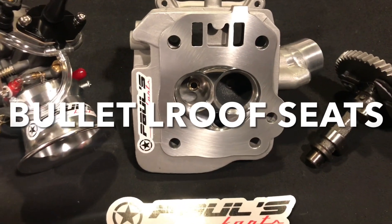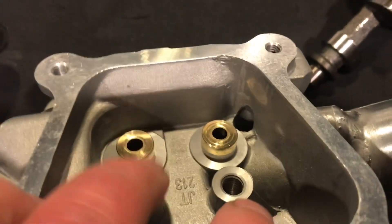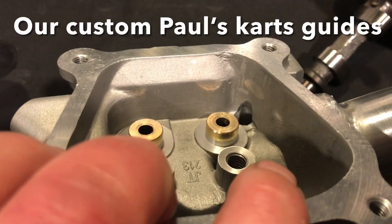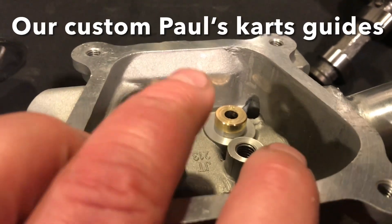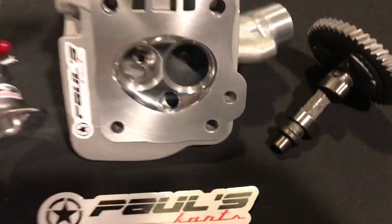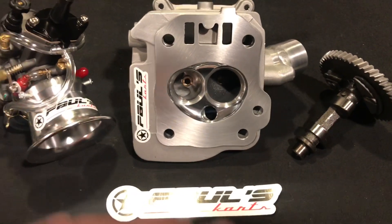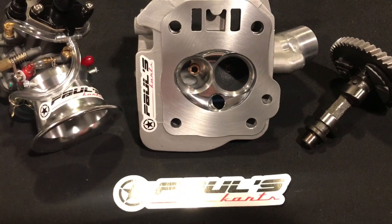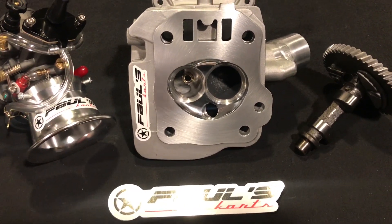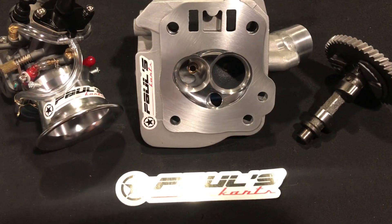Two solid complete seats, neither one ground on the other. Another cool feature we have here at Paul's Carts is the custom bronze guides with the little head on them — see how that head is sitting down on top of the boss. That prevents it from falling through; this guide physically cannot fall through. The spring pockets are cut, and we always mill the head just one or two thou until it fully cleans up, because I've found four to six thousandths off on some of the factory castings right out of the factory.